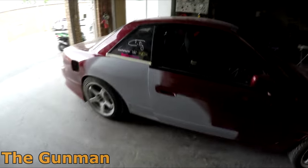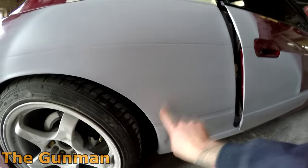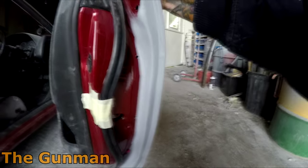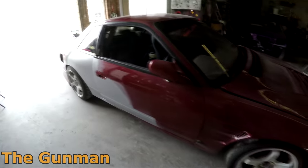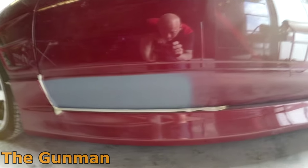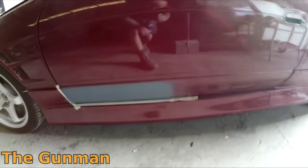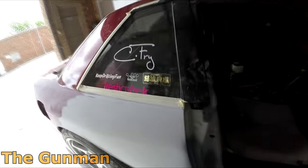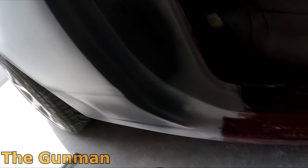We're getting this painted today. First off I'll be checking my color. There are a couple of little pinholes that probably didn't quite fill up, so put something in there again and give it a block down. Got to paint all this door swinging, which should be pretty fine. Had to strip the door out, get the handle out and take the mirror. There was another little bit I never got told about — my partner forgot because he had a hangover on Saturday — so I had to re-prime that bit. It's just 1K, put like three or four coats on.